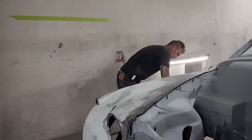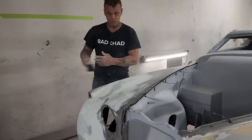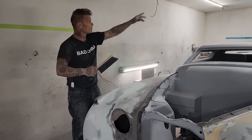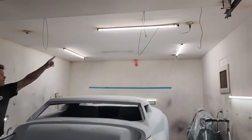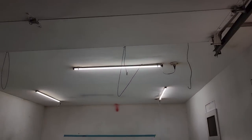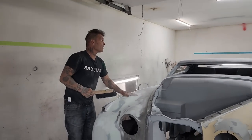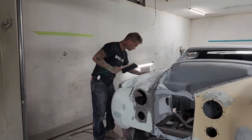And it's the exact same thing, I keep saying it, as your drywall. When you do your drywall, if you do not feather it off good enough on your ceiling, you can see it right here. Right beside that light, you can see that seam on that drywall, can you see it, sweetheart? It's not perfectly feathered. It just hasn't got enough filler on it, and you can see it whether it's hitting or not.